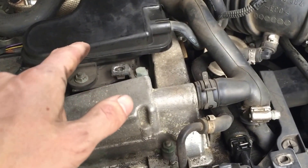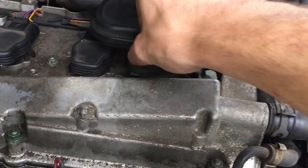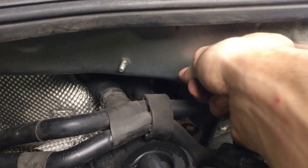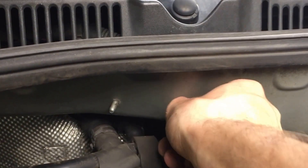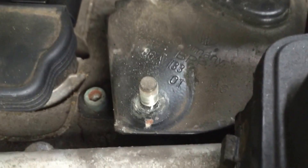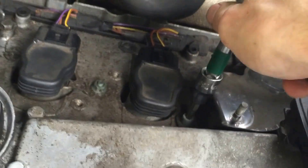All I really need to do is remove this bolt, and I've got a piece of vacuum hose — that's really all you need along with a couple of hose clamps. This is a 10mm socket. I'm just going to move this over to one of these — and the good news is it's also a 10mm, so save this nut and reuse it. You'll also need to remove these little bolts; a Torx T30 will fit — I just couldn't find the right Allen key.